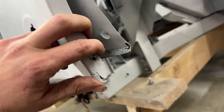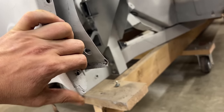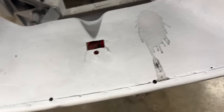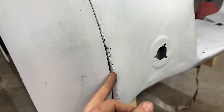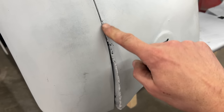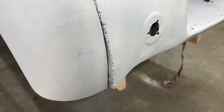On this side there's another crack right here that we want to weld. Ideally we should put the fender so we can match this curve, but here it's pretty clear where this needs to go, so we can push it in, weld it, and grind it. We need to weld and grind these two cracks here. The biggest repair we need to do is here - this flange has been totally budged here and we still have a crack right there inside, which allows us to reshape it. Maybe if I can reach from inside somehow - to weld it where it's supposed to be and then grind this better. Or we can cut it completely open. We will see what we're going to do.